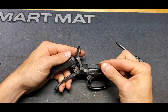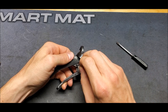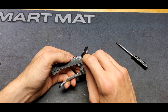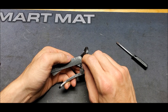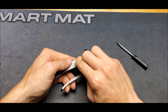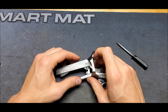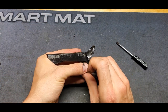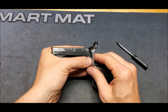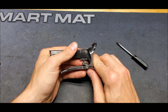So we will use our little nail improvised punch. And this pin feels pretty loose. Yeah, it feels like I'm just gonna be able to push that out with hand pressure. So that's your timing rod operating lever pin. It'll push out, and your spring tension will hold your punch in there. So we'll set that right up there. And since there is a spring in there and I'm not sure exactly which way it's gonna go, I'll put my fingers over there